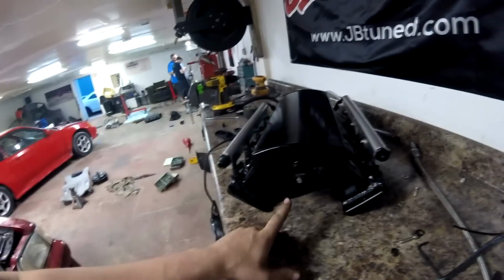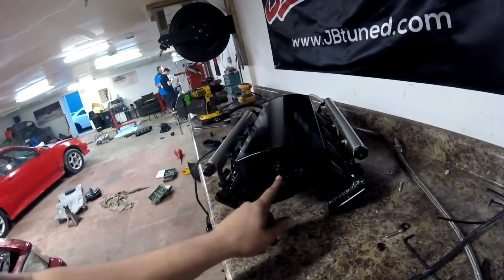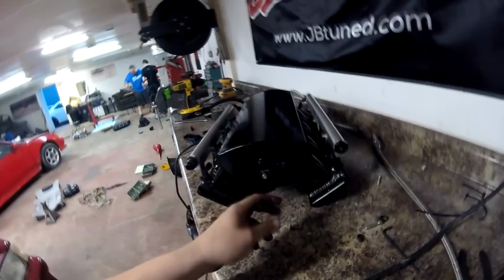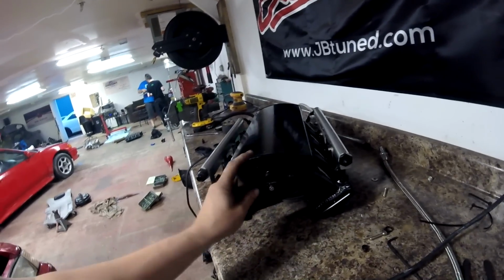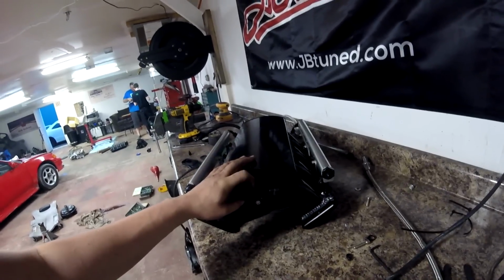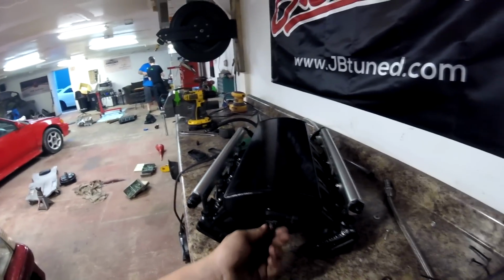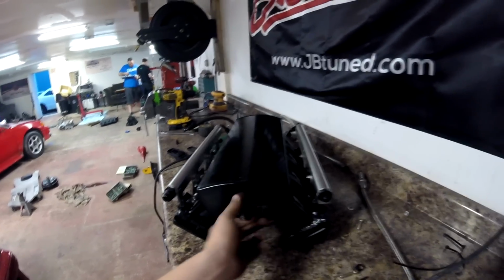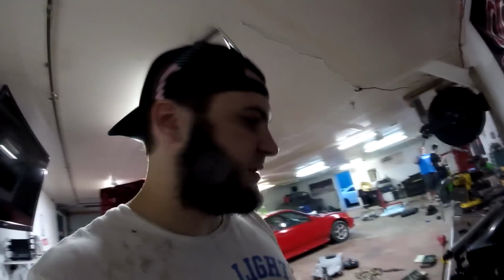This back port on the manifold was plugged, and then you take off this little plug thing, and there's like a wide open hole there. So I kind of finagled an O-ring on top of the normal rubber grommet that sits on the map sensor, and I used their supplied washer and bolt to bolt the map sensor down. So the map sensor is actually on the back, pretty snug, shouldn't leak. Honestly, if the LS1 intake manifold map sensor didn't leak, this one definitely won't, because factory LS1 is just like a little clip. Like, I can't believe they don't blow out. But anyways,